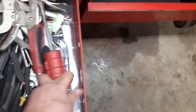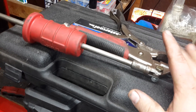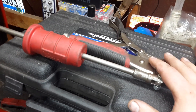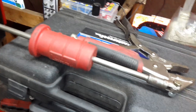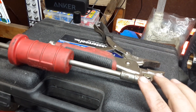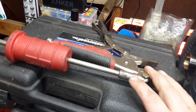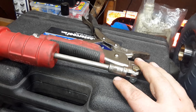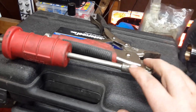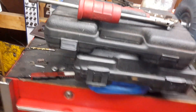These are my Las Vegas Tools — vice grip style, slide hammer, I think it's one or two pound. This company's out of business now, you can buy stuff like this on eBay but they look like shitty pairs of vice grips. This thing will bite real good. I use it for pulling out cotter pins and dowel pins on engine blocks between the transmission — just shit like that. Real handy.